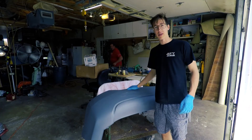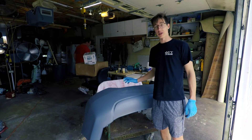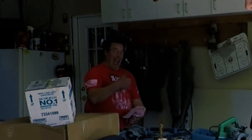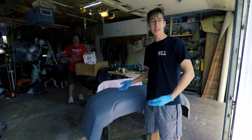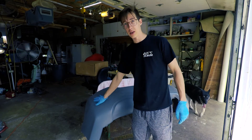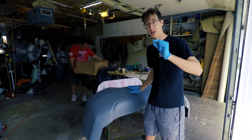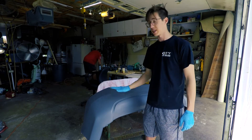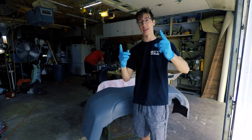I actually haven't recorded in a little bit, but I've made a lot of progress on the bumper. I ended up doing a total of three coats of body filler, sanded all that down, and I have now done about two to two-and-a-half coats of primer. What I'm about to do is sand down all the spots that look bad — the primer really brings out any little imperfections in the body filler — sand it down, do a tiny little coat of body filler, sand that down, do another coat of primer, and then she'll be ready for paint in the next video.